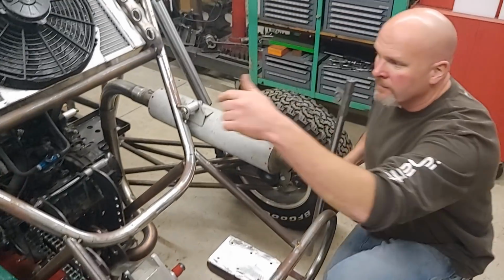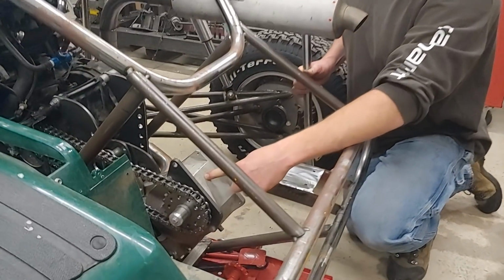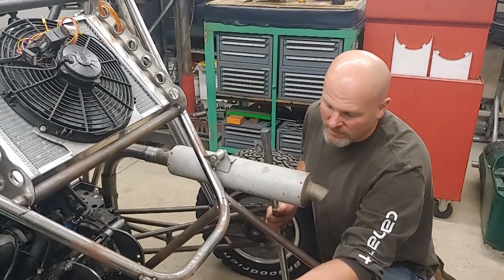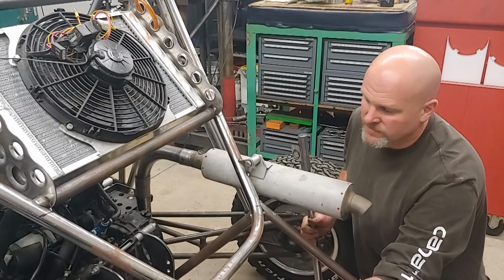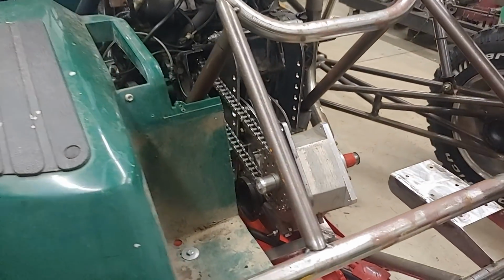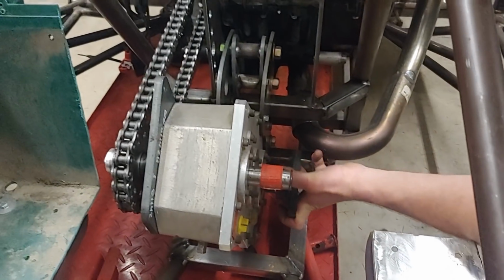Okay, so the street bike engine obviously has a chain. That chain comes around to this RPM gearbox. RPM is just the brand name of this gearbox. The gearbox has a 5-to-1 reduction, and it also gives you forward and reverse. So it's the perfect way to put reverse behind a street bike. So the chain is the input. The output is over here, is this flange. So you see if I turn this flange, you can see the chain moving, right?